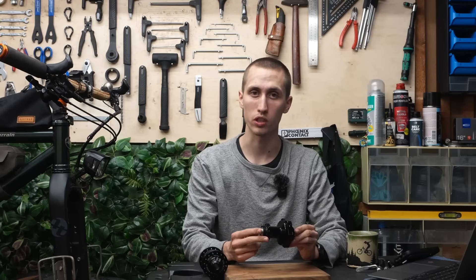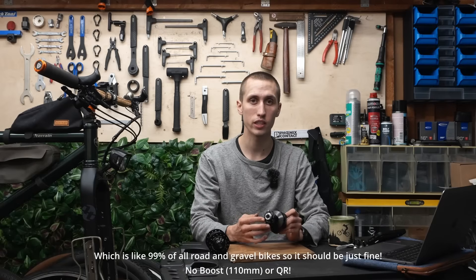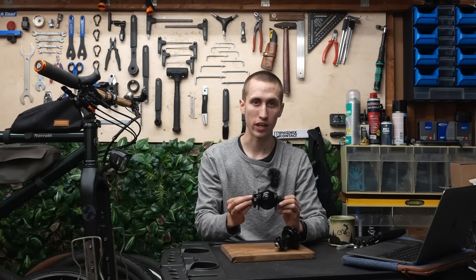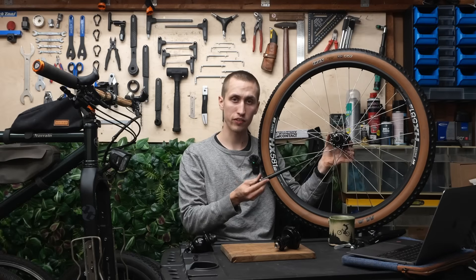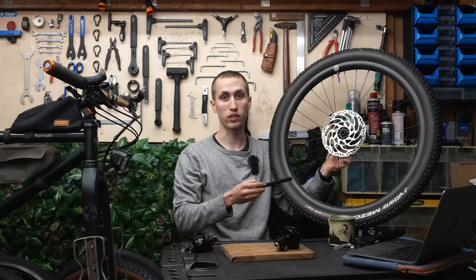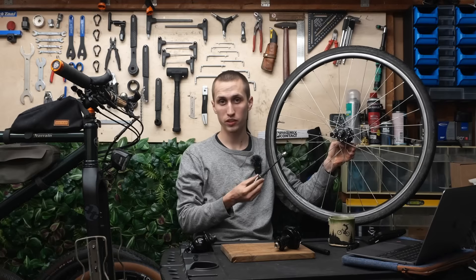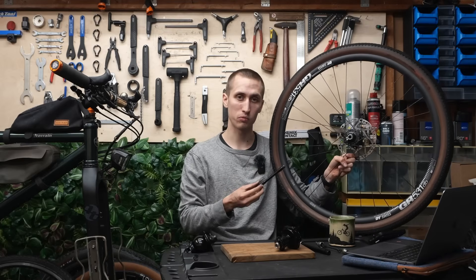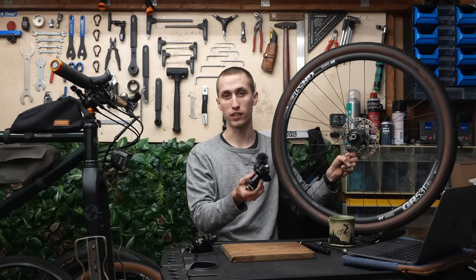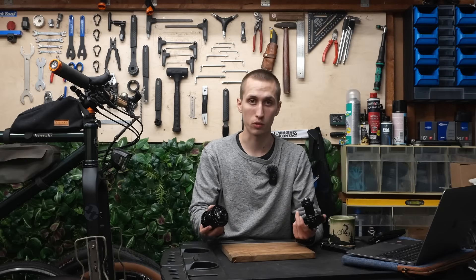Because this is a relatively new model, it isn't available in many variations. It is only compatible with a 12x100mm thru axle. The 28 model on the other hand is available in 15mm x100mm, 15x110mm boost standard, as a quick release skewer, and also in 12mm x100mm — just like the new 29S. Which one you should get is therefore also determined by the standards of your bike.